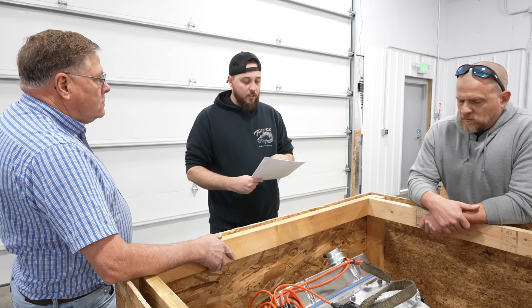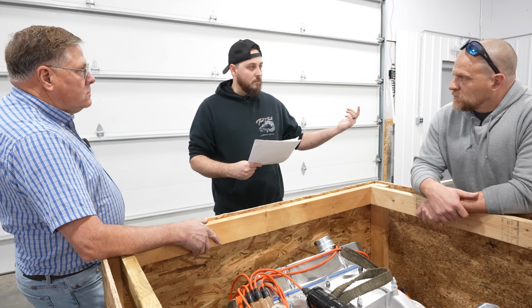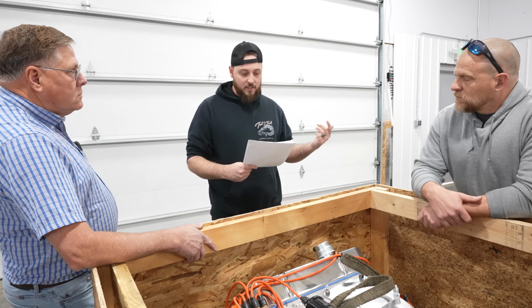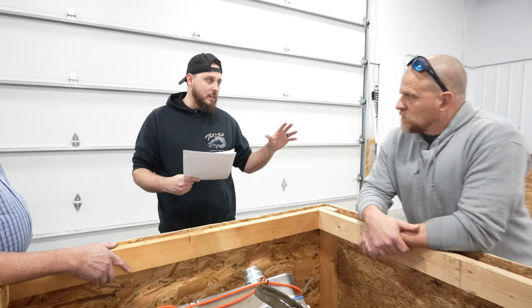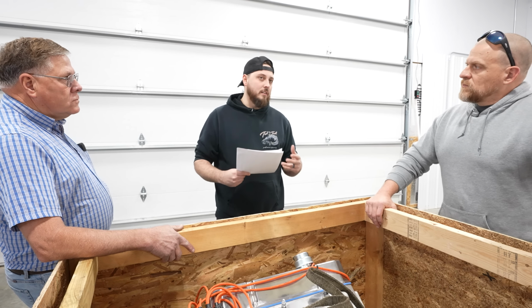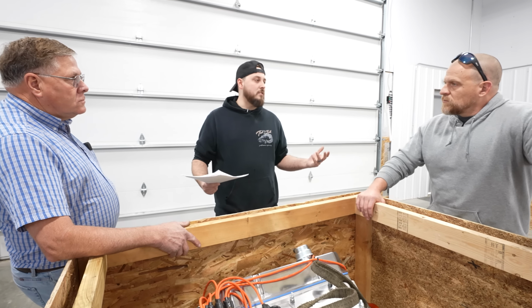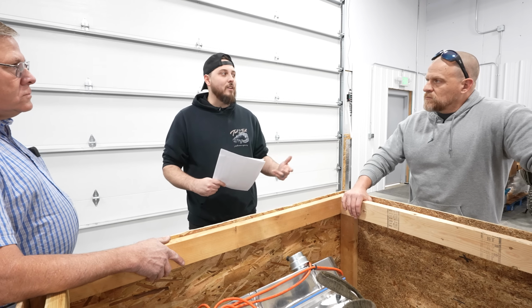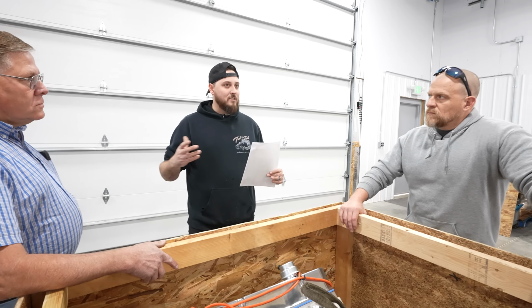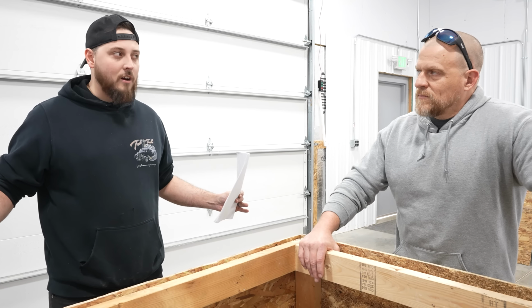But I did note on here, we tested on November 29th. He's at roughly 5,200 feet elevation, 32% humidity roughly that day, and the test cell temperature was roughly 70 degrees. The reason I'm telling you this is because there are correction factors. Most of the time when people give you dyno numbers, they're telling you a corrected number. Because when you're at elevation, an engine doesn't run as well as it runs at sea level. That's just the cold hard fact of it.